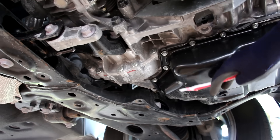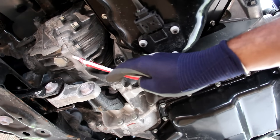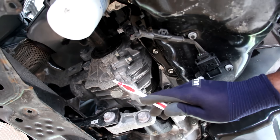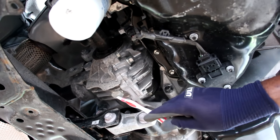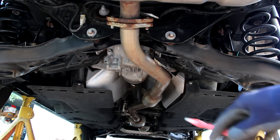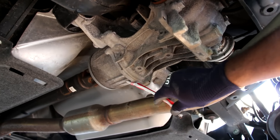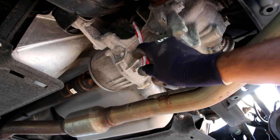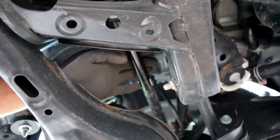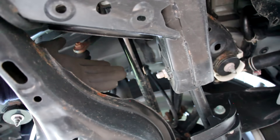Once the transmission is done changing the gear ratio it sends power over to this front differential. This is an all-wheel drive model so that's going to send it to the front wheels, but some of that power is going to be split over to this transfer case. The transfer case takes rotational energy and translates it 90 degrees to the drive shaft coming out the back for the rear wheels. Servicing the transfer case is pretty straightforward — you have a fill plug at the top and a drain plug down below. That drive shaft sends power to the rear differential. Just because Mazda says it's got G-vectoring control doesn't mean this is actually a torque vectoring differential. Just in front of that differential is a clutch pack which controls the all-wheel drive system — that's what's going to engage and disengage this rear differential. The rear differential and axles are pretty small in diameter, so you can definitely tell that most of the power is going to be sent up front, and at most maybe 50 percent will be sent out the back momentarily just to help you over that speed bump.